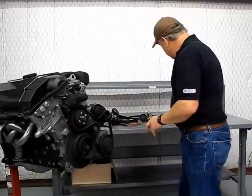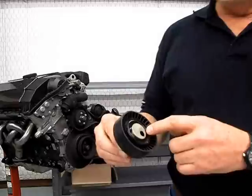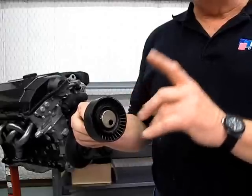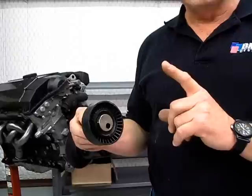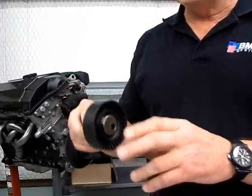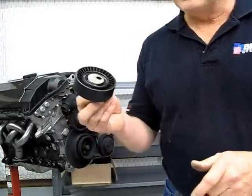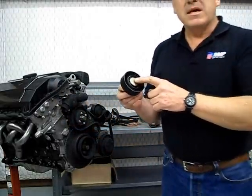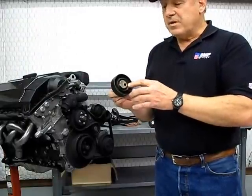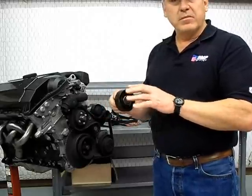At 6,000 RPM, you're relying on a small plastic wheel with a built-in bearing. That built-in bearing is constantly running with lubrication supplied from the factory just one time. This bearing here has failed — I'll let you listen to it. It sounds like a worn-out skateboard wheel. At 3,000 RPM for two or three hours, that pulley will eventually fail. The bearing will seize up and the belt will shred because the pulley alignment goes all off.